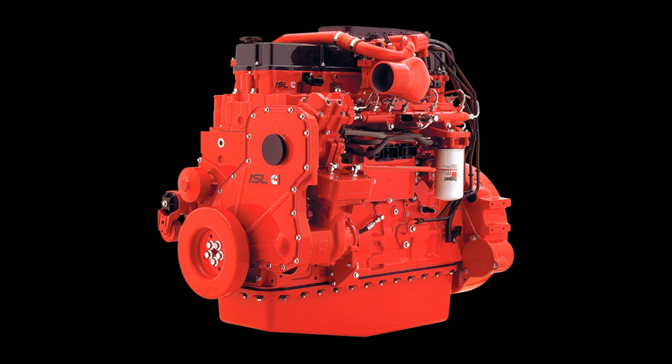If you're running one of these engines in your own personal truck, it'd be a good idea to pull this sensor off and clean these ports out once in a while just as preventive maintenance. Here I'll just give you a quick look at where these ports are and how to clean them out.